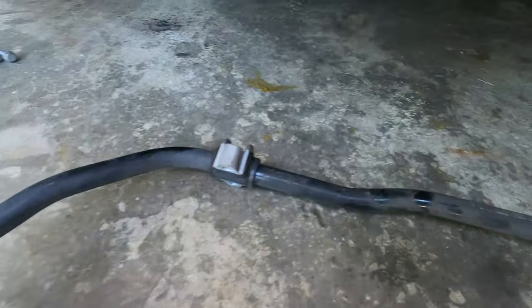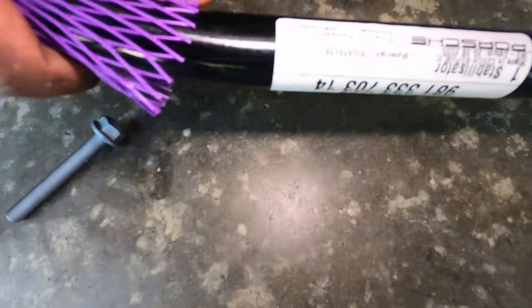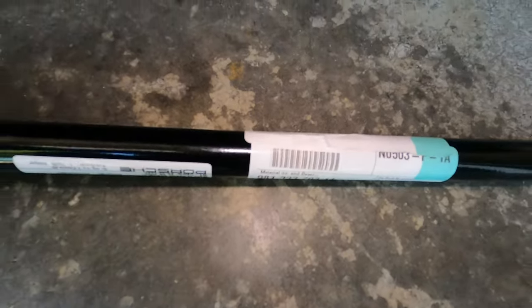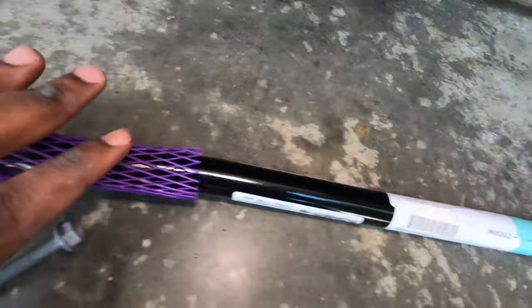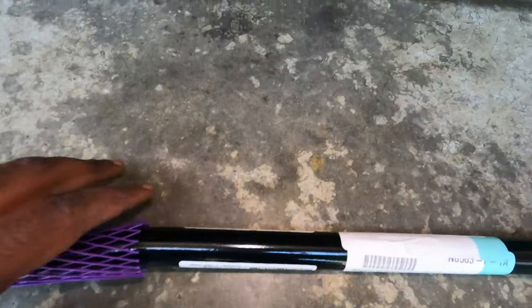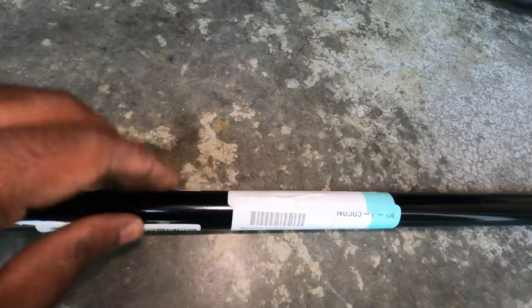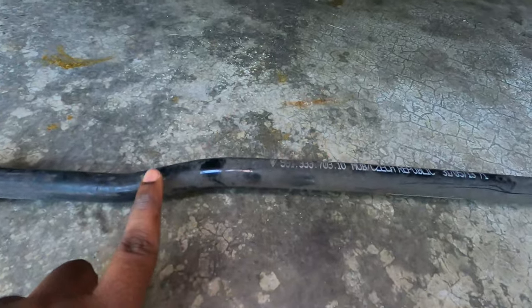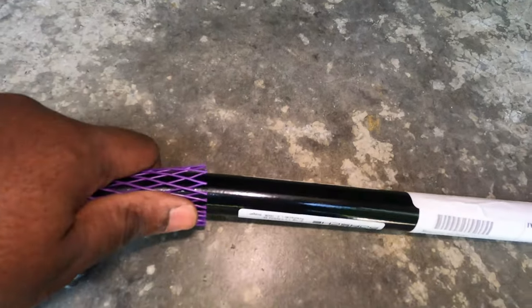The sway bar is up. This is the old sway bar right here - the part ends with 10. And this is the new sway bar - the part ends with 14. One of the main differences is the shape. This one has a little different shape than the factory one. This is the X73, and the X73 is a plain full, meaning the material is all the way in - compared to this one which is hollow, meaning there's actually a hole inside in the middle, meaning it's not as stiff. This one weighs maybe two and a half times that one right there.